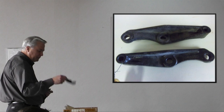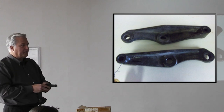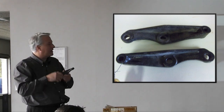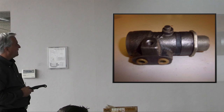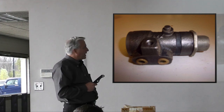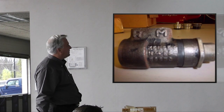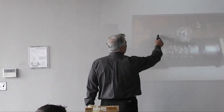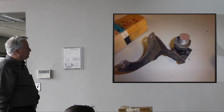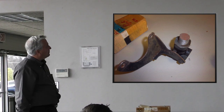Here are some caliper support brackets — unfortunately these are all the '68 and newer ones. The early casting numbers stood up so it's easy to pick them out from the later designs, where the numbers are stamped into the bracket. That's a pressure-reducing valve — they were used through '68; in '69 they didn't use them anymore. They had a special bracket mounting them underneath the master cylinder in '65, '66, and '67; in '68 it went down to the frame. One side is marked R for reduced pressure to the back and M for the master cylinder.